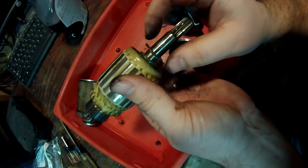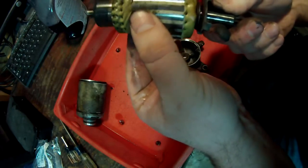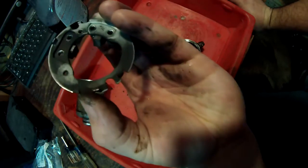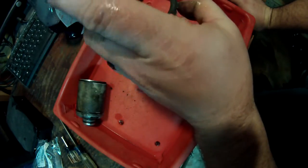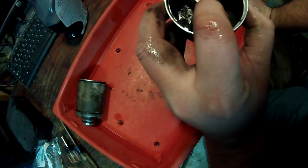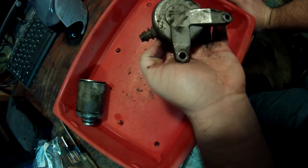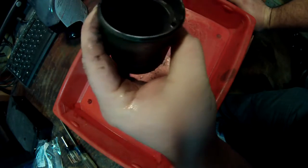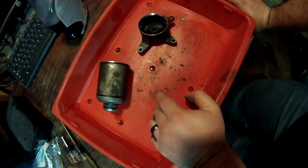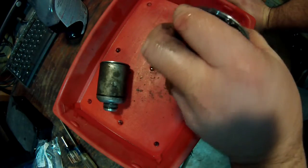This is the side with the two washers on it, not the other side. Pretty much this is fine, so I'm going to sit this to the side. The rest of this will be what I clean up - I probably won't touch the armature. It's a little bit dusty but I really don't want to mess with it too much. In here we've just got a little bushing - everything that that spins in. It's a Mitsuba starter brand. Everything looks okay in here, so I'm pretty much just going to clean it up and then look at the diagram really well to see if there's a piece around this nut here, because I've still got to get that off since I need to replace it.